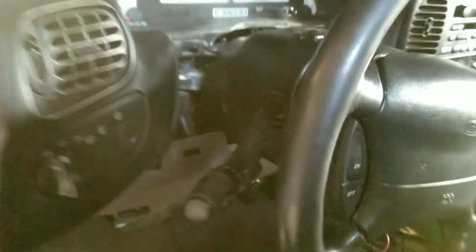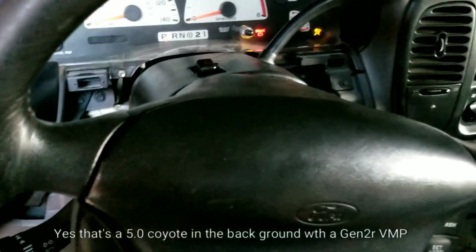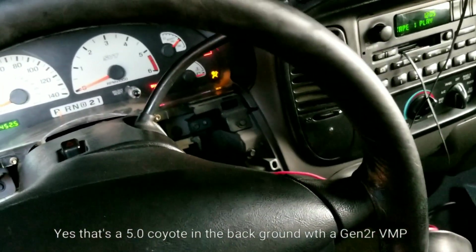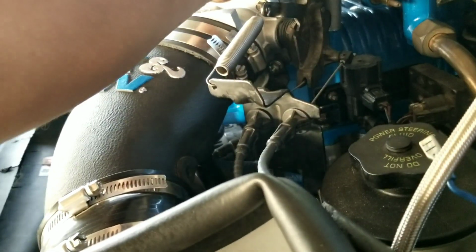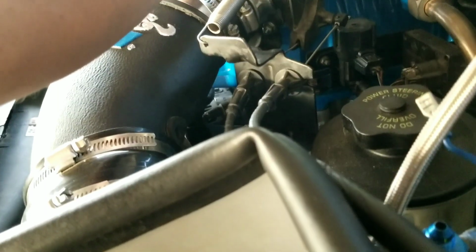So we turn on the ignition to the on position, then turn this thing on, and you'll see your light come on. So that means it's on. When you're installing the whole thing brand new, this light's gonna be red. So you gotta push that button. Like I said, leave the ignition on. You don't start the engine. Press that button for maybe like 2-3 seconds. Let it go. It's gonna turn red. Then you're gonna hit wide open throttle for 10 seconds. So you count 10 seconds from 1 to 10.